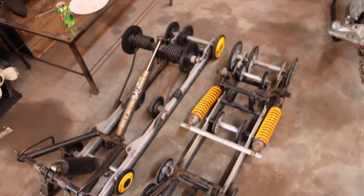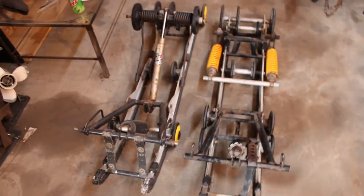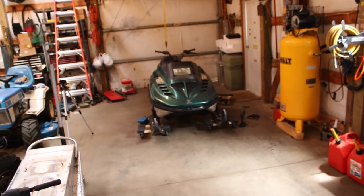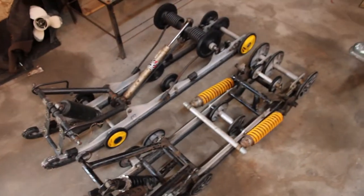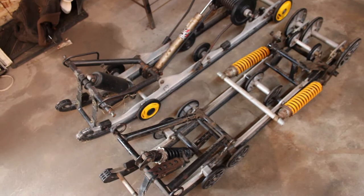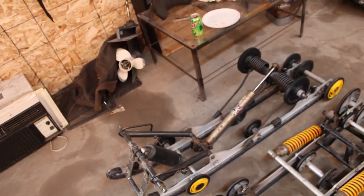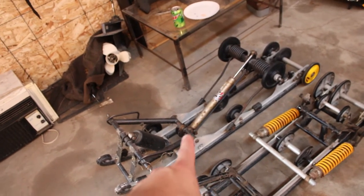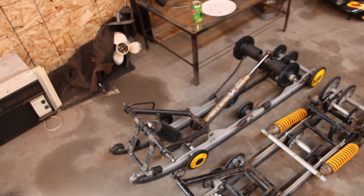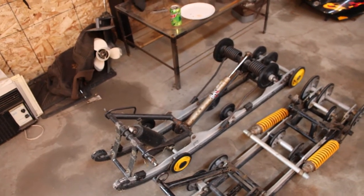Here are the two skids side by side so you can see some of the similarities and differences. I really don't know how much weight we're going to be losing going from the C7 to the SC10 — they actually feel pretty comparable in weight. The back of the C7 seems heavier, probably because of the big heat exchanger back there. If anything I'd guess we might be losing maybe 5 to 10 pounds just by getting those dual shocks off the rear. I think I'll actually be able to use a set of those idlers to replace the missing ones. I'm going to take the SC10, pressure wash it and get it cleaned up, then see if I can scavenge a bushing off the old skid for the lower shock mount on the front arm — it's got a little slop or wobble to it that I want to tighten up before installing. The slides are in decent shape yet, so we might as well just toss it in there and call it a day after cleaning it up.